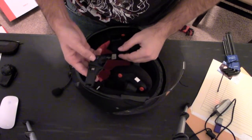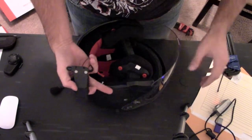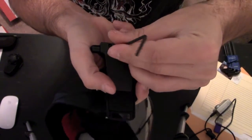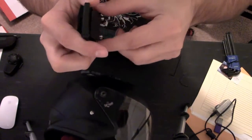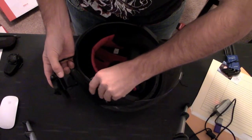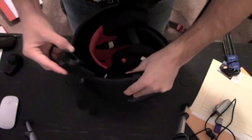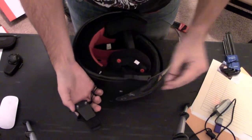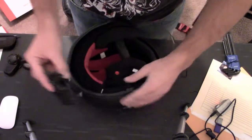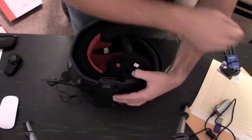Once you get those two ear pads taken out, go ahead and get your mounting hardware for the Bluetooth onto the helmet — that's really simple. Grab your 2.5 Allen key, you've got these two screws right here, and you just go ahead and loosen them up a little bit, which will make the plate move back and forth. You want to mount it on the right side of the helmet. There's usually a gap right here between the padding and the helmet — you're going to slide the back plate right in there. Loosen up just a little bit more, slide that over, and once we find a good spot we'll tighten down those screws.